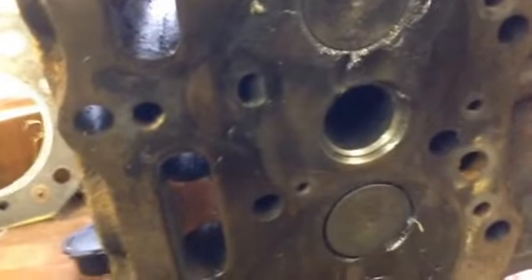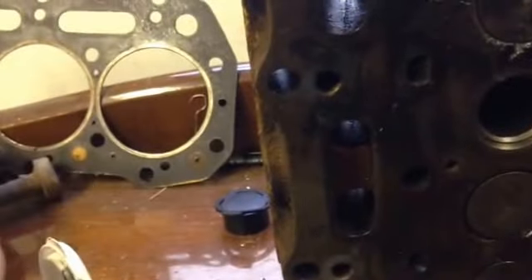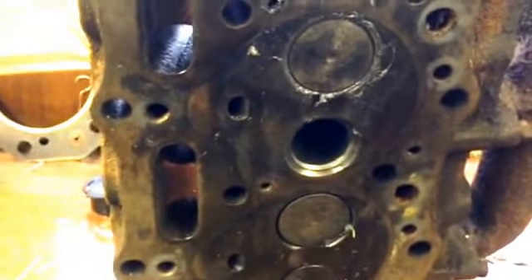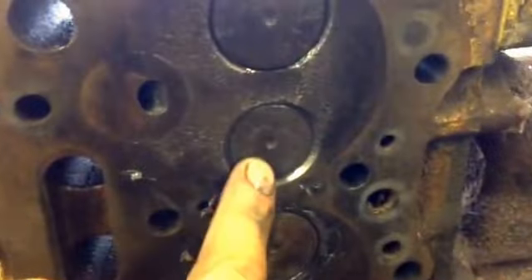What I do is I get some grinding paste — here's some coarse and here's some fine. I grind the pits back with the grinding paste. This head is pretty much junk; I've actually cut this valve back almost 2mm to get rid of the pits in it. That's how they should sit — that's 2mm on one and more like 3.5mm down in on another.